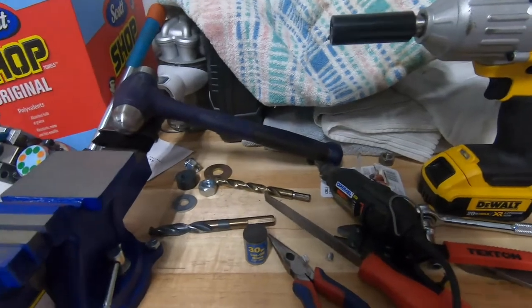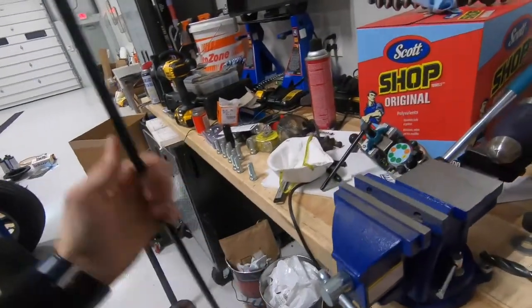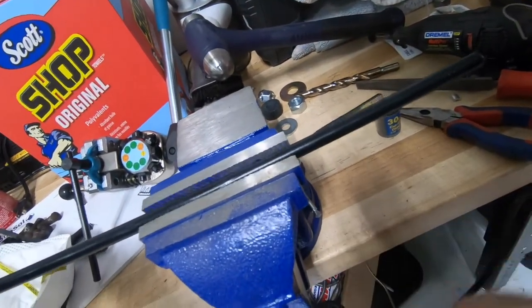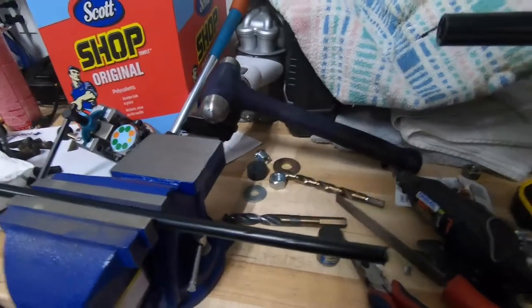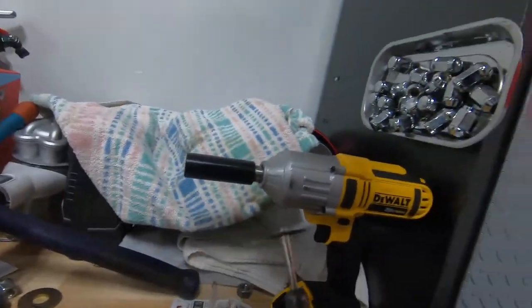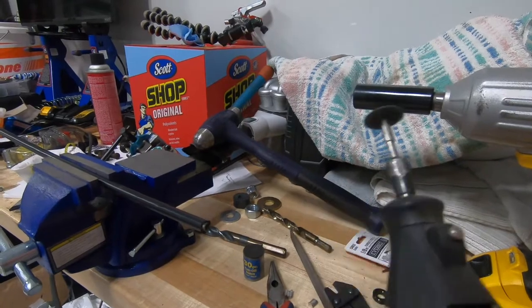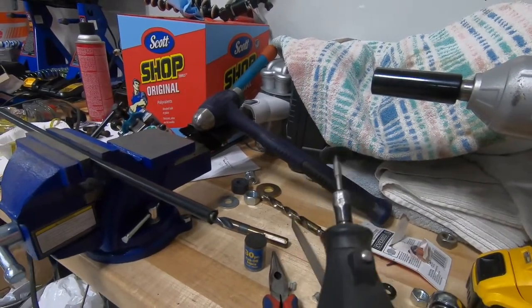The sheathing is a metal tube, but you don't want to use bolt cutters to cut it because you risk compressing and constricting the metal tube on the inside — obviously not what you want. You want a clean cut, so I've been using my Dremel tool with a cutoff wheel and it's worked pretty well. I've gradually cut it down; I probably could have measured better.